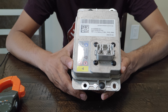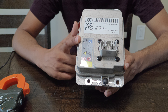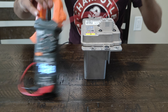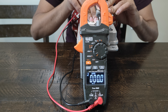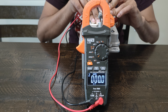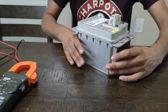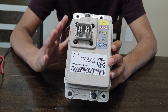The first way is you have it plugged into the car, then you're gonna put your foot on the brakes and try to see if it'll charge. You're gonna test it with a multimeter — put it in DC, connectors in positive and negative. As long as you're getting voltage and it's going up, you should have a chance to recover it. Even if it's at zero, I'd still tell you to try it, because to replace it you're looking at $200 to $250 or even more depending on where you live. So the first way, you just plug it in and let your HV battery charge it — that's the easiest way.